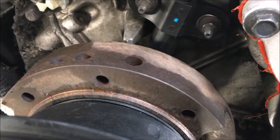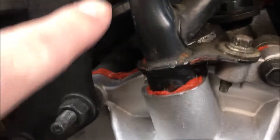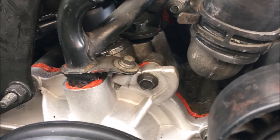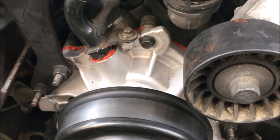While you're down there, it's a good time to change the crank position sensor because it's right there once the water pump is exposed and out of the way. Your cam position sensor is right behind this bracket right here, so that's also a good time to get your cam position sensor out, because those are common fail sensors after the hundred thousand or two hundred thousand mile mark. This one has over two hundred thousand, so rather than wait for the sensor to fail, you change it out.